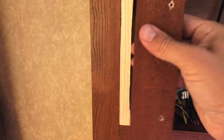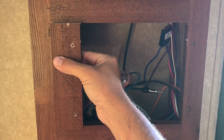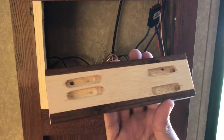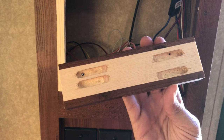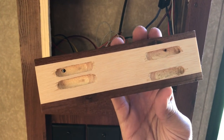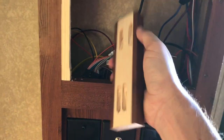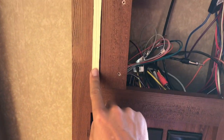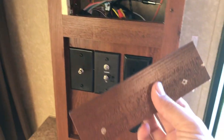Normally what was in ours was this filler piece right here. The four screw holes were what were used. This filler piece just has some cradle jig things in it — two screws going up and two screws going down. Like typical RV building, there's no good fit and finish. You just have to stick the screwdriver up from behind, go up at an angle and then down the same way. Get those four screws out and the unit just slides right out — no nails or glue or anything holding it.